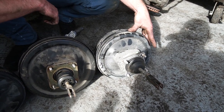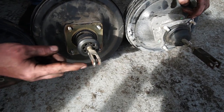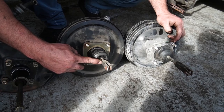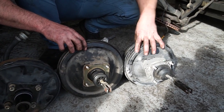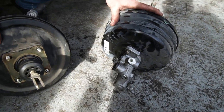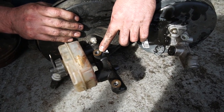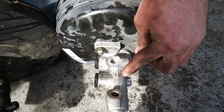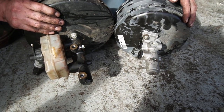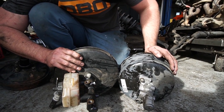The third option — which we're going to explore — I think there might be some brake line snafus to work out. The rod length, as far as the mounting point on the firewall to the mounting point on your clevis here — this fork is what mounts to your brake pedal — and the distance from these bolts to the end of this rod at the nut is almost exactly the same. So as a result, this E34 booster should work for the S52 or any of the 24-valve swaps. What I am concerned about is the brake lines: on the E30, you've got a 12-millimeter flared nut, and on the E34 and E32, this is an 11-millimeter flared nut. So there is a difference in diameter and size, and we may have to make an adapter hose or something. First, I'm going to mount it up and see how well it fits.